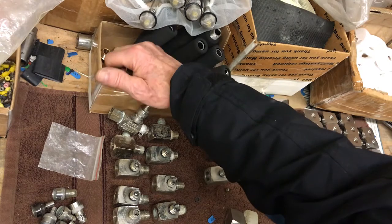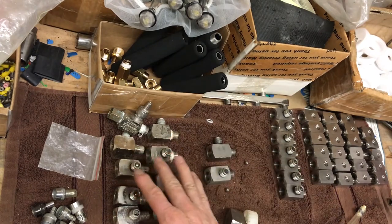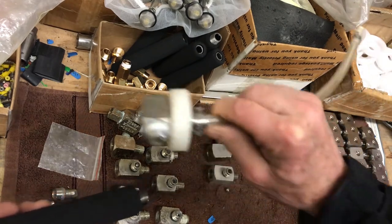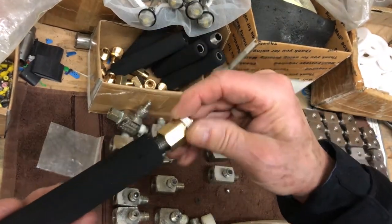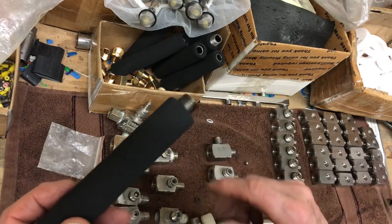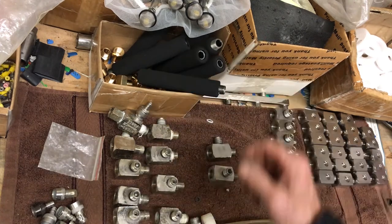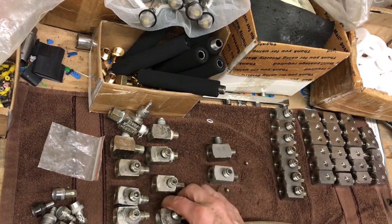The quick change adapter is a really useful little adapter that you can start installing in the back of your existing injectors. It makes it possible for you to remove the handle assembly from an injector that's giving you trouble and swap it out with one that's got a reworked or brand new draw tube — screw it in there using the quick change adapter with just a wrench. If you don't have this, you're going to end up using a pipe wrench on your tube, which most of you don't have on the truck. You have to go to the supply house and walk out with a brand new $180-plus injector that you didn't even need — you might have only needed a $10–$15 repair.